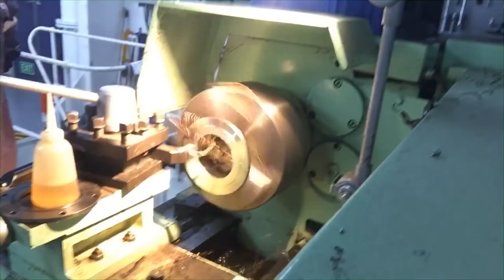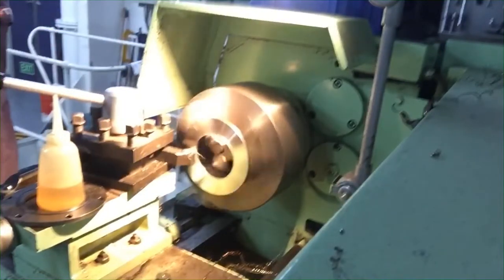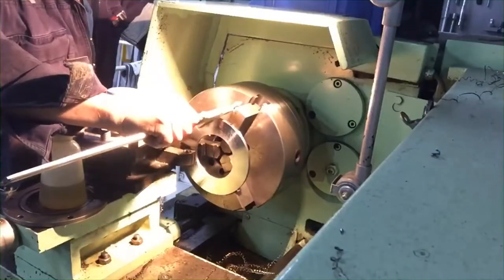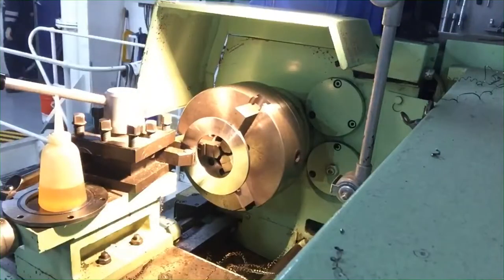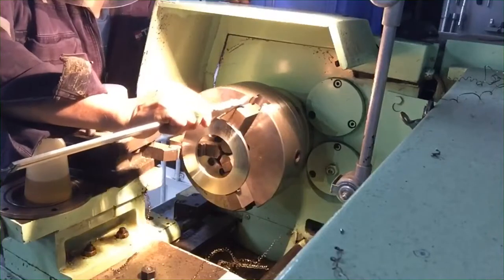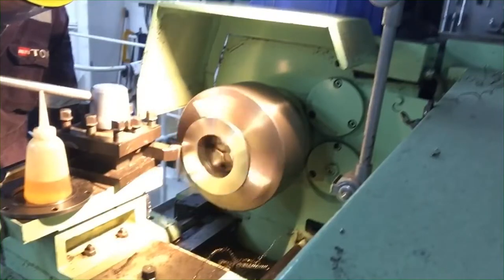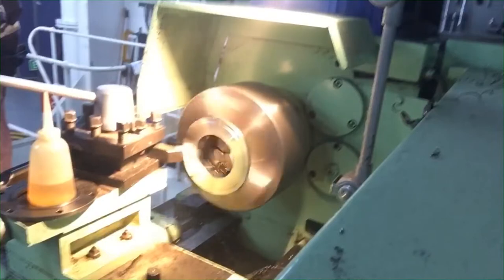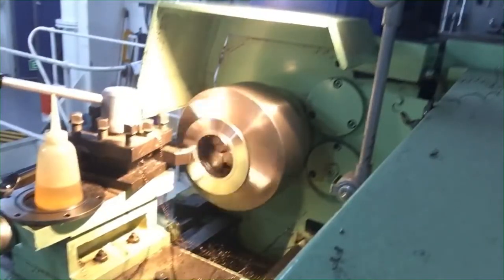Because of the triangle of fire present inside the crankcase: heat, fuel, and oxygen. That is the triangle of fire. So I'll explain one by one. The heat is the friction between metal and metal. So when the metals touch each other, it will create heat. The fuel is the oil in the sump tank, and the oxygen is created when the compressor is running. So it means that all three elements of the triangle of fire are present inside the crankcase. If the triangle of fire is present, it will create an explosion or fire.